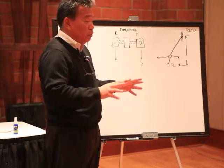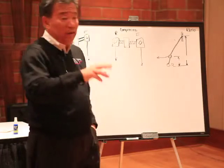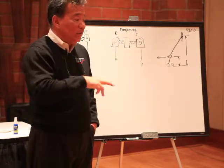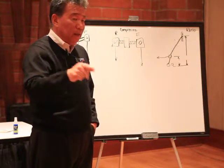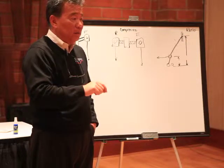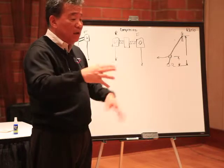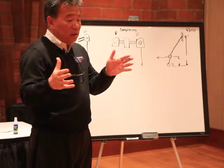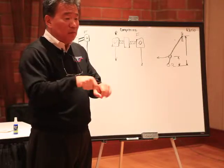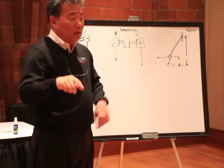This is something that you should get used to: when you go to bleed a balance braking system, or you're bleeding a road car package that you're high-performance driving or racing, you should get into the habit of bleeding both a front and a rear at the same time. So this is essentially a three-man operation, or you have to have something like a vacuum assist or an assist-type system where you can crack the bleeders and it flows the fluid out accordingly.